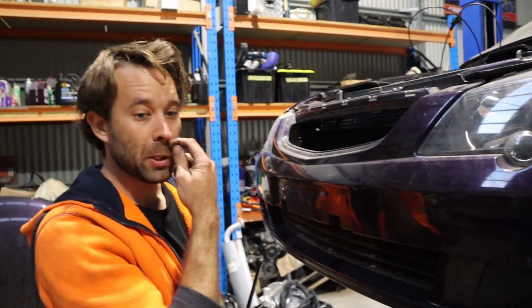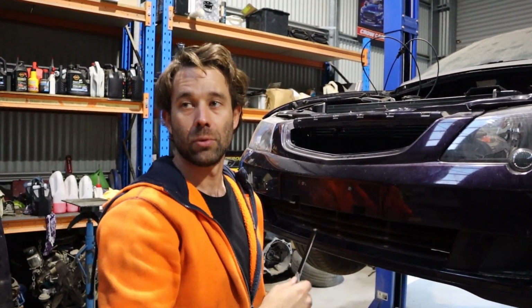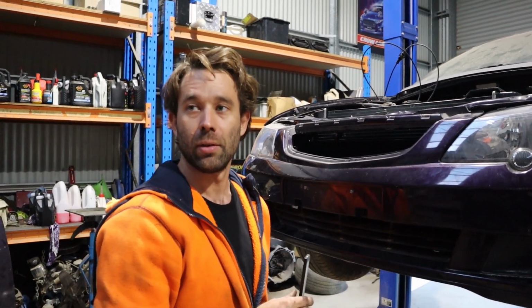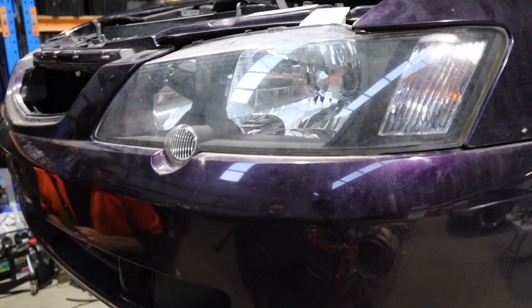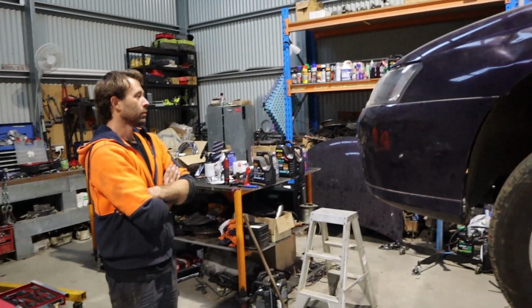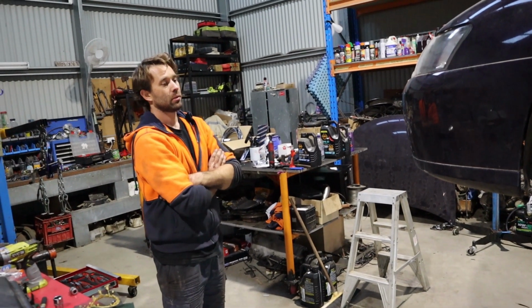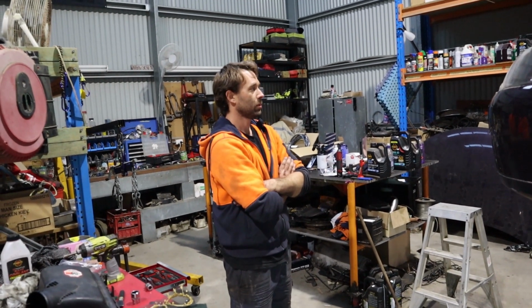When we tune it, what I'd like to do is put a port in the intake tube, see what sort of vacuum it's pulling, and log it, to see if it's pulling vacuum under boost. That way we'll know for sure if that's a restriction or not. Just an interesting little test to do. Good little bit of progress. Unfortunately, I just don't have both of the oil coolers here to do the oil cooler mounts.